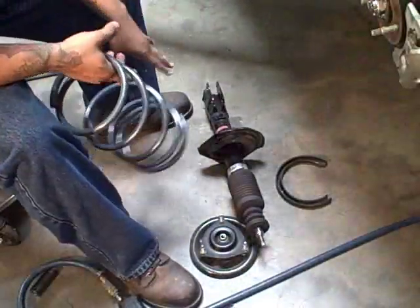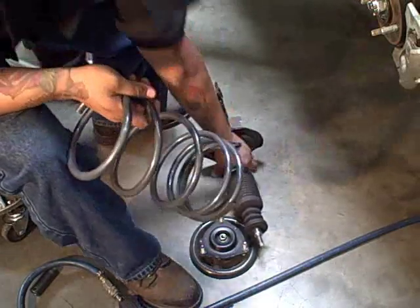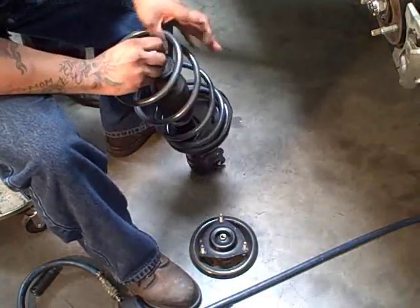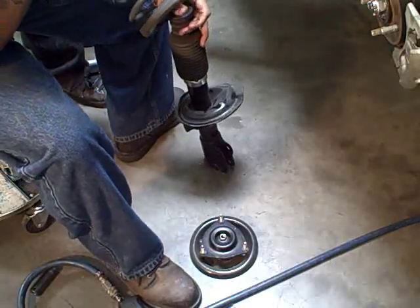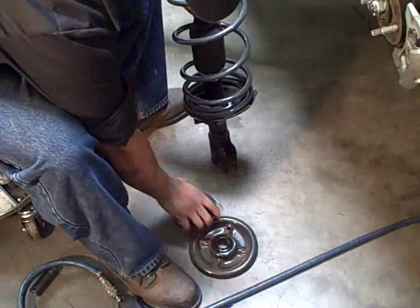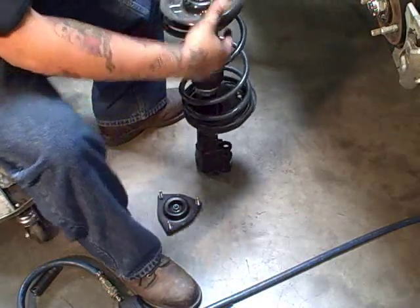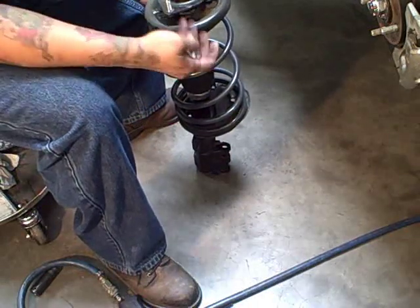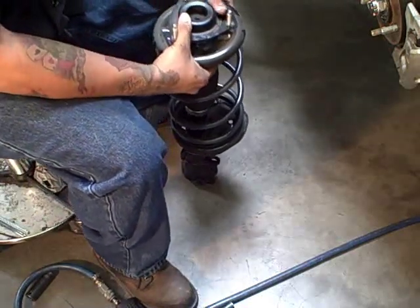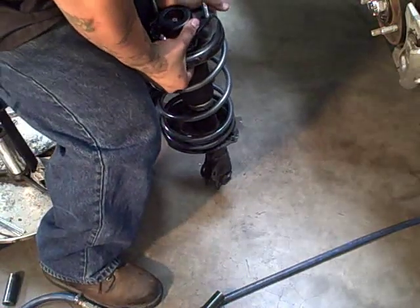Now to reassemble your shock assembly with the new spring. Basically all you have to do is put this little plastic piece back down here and reinstall your spring. Now if you take a look at your stock shock, there's a hole right here which has to be lined up with the hole on the hat. Once you get those lined up, get one of your buddies to help you out — Carlos is going to do that for me here — and center the rod on the shock assembly. Push down as hard as you can, just enough to get the threaded part through.